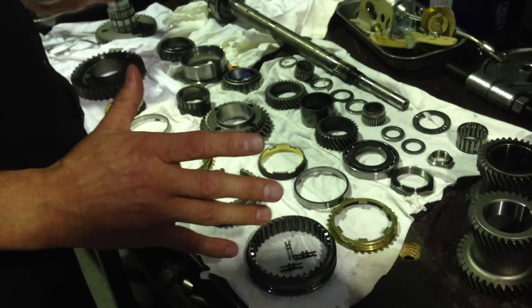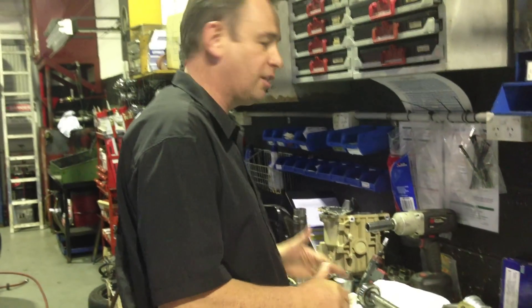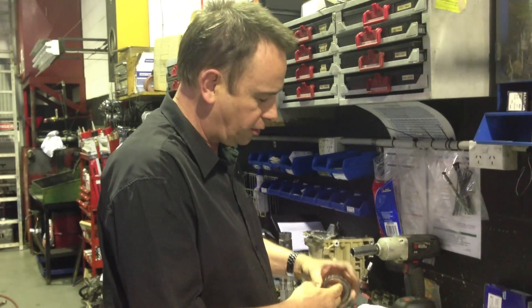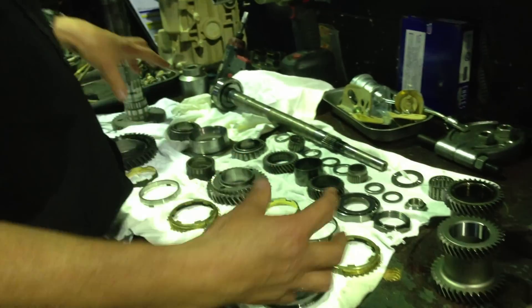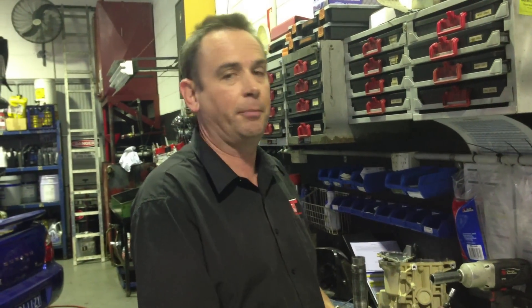One thing I wanted to remind you: when you're suspicious of a damaged gearbox in your car, stop driving it. Because one of the most expensive repairs, other than the broken gears, are the bearings, which have to be replaced if you keep driving your car. All the little broken bits go through the bearing assembly and destroy all the bearings, and then you can spend quite a lot of money replacing the bearings as well as the broken parts in your box.